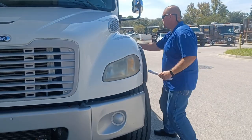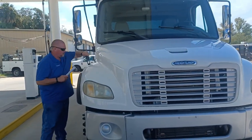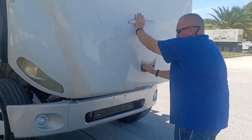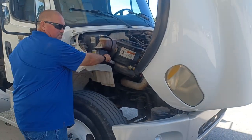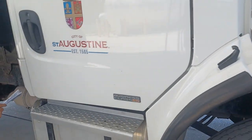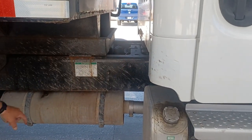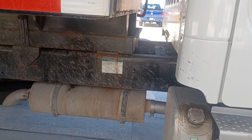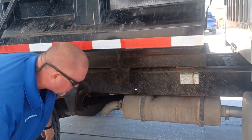We're going to go under the hood — be careful when you open the hood. We're going to move our way back to the end of the exhaust. We're going to start here at the exhaust manifold, follow the exhaust pipe all the way back under the cab to where it comes out down here in the muffler. We're checking the muffler and all of the exhaust pipes for leaks. If you see soot right here, that means the exhaust is leaking.